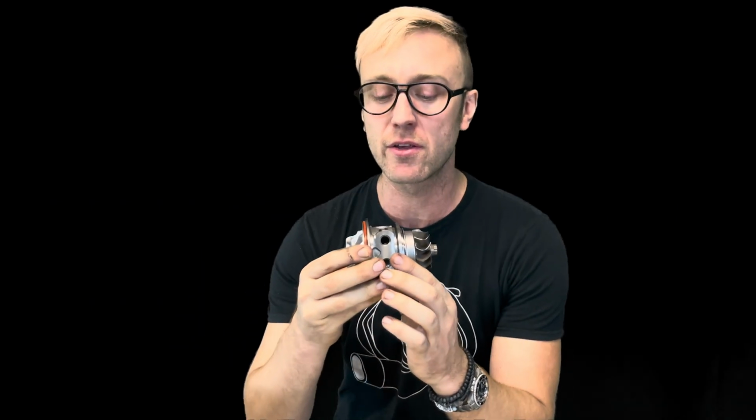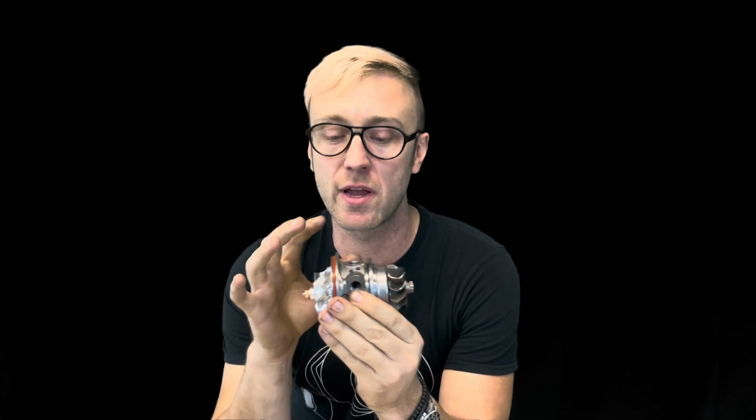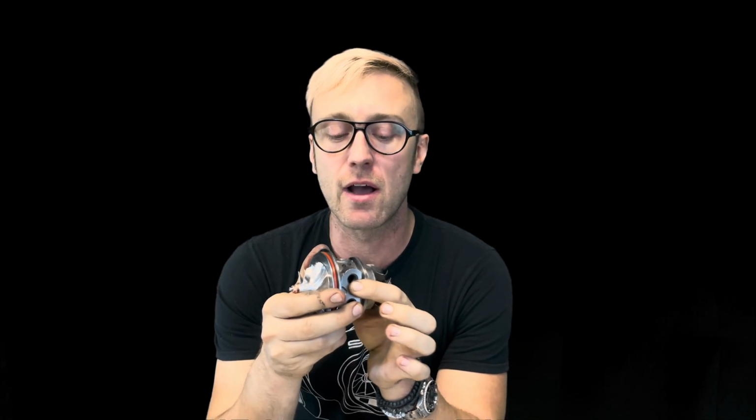I've got a 6x6 here and a standard 12 blade. This is going out to a customer relatively soon, and this is a pretty common setup. Mind you, most of the Mitsubishi TD04s that get shipped out of here are usually 19Ts. We do have occasional 20 or 22T, and once in a blue moon, maybe a 20G. We are going to start with the exhaust side. On the CHRA, this is also known as the turbine wheel, and some people just call it an exhaust wheel.